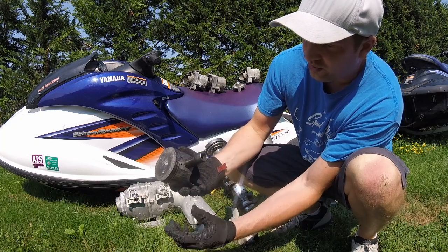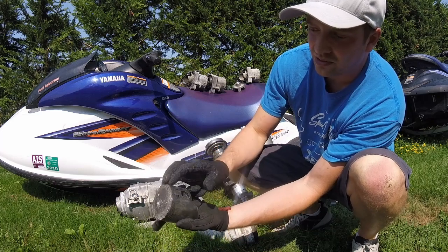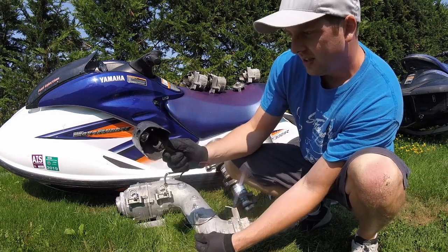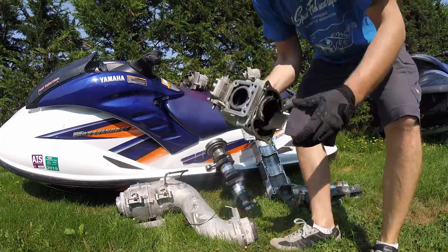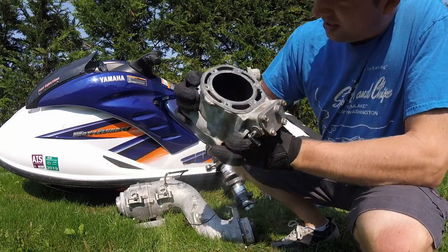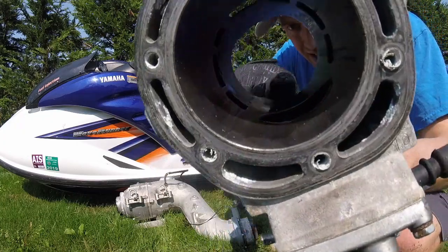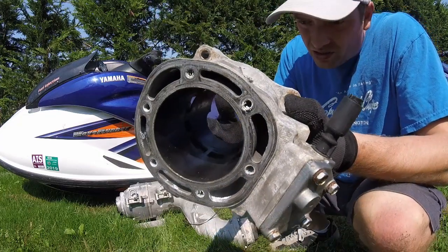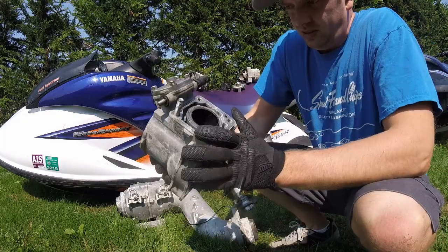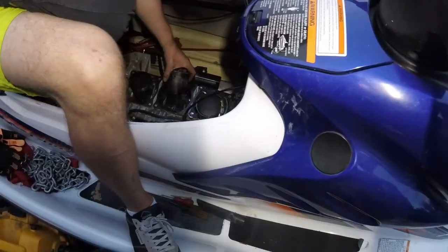The hole on the other side — you can see all the rings have been vulcanized to the piston itself, so this is clearly trash. It wouldn't run well. You could get this to run if you welded this hole and tried to clean everything up, got your rings out, cleaned out where the rings sit, and somehow were able to get this wrist pin back in there — but it would probably run for a little while, but not very long. So that's the piston. Here is the cylinder from that center section. You can see it broke the skirt off. It's fairly well scored up inside. There's a little chip off — I think that's the intake port. This is not usable in this condition. I would have to have this rebuilt. I believe this could be sleeved. The one in the middle is definitely grenaded.